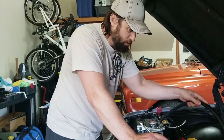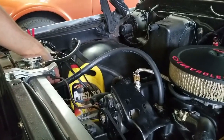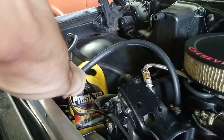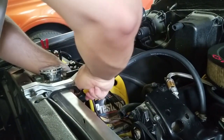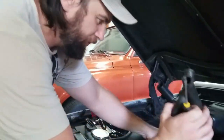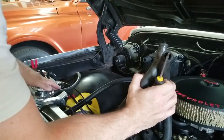So I'm going to take these off and we'll see if this hose will go from here to here. So I just replaced the hose — nothing too crazy. I did spill some coolant, so be prepared for that. I'm going to tighten this back down with a flat head and then we'll top it off. This hose that was on here was definitely not rated for heat. This is what we pulled off — it doesn't have any of the white lining in the middle that gives it strength. It's just a piece of hose, going in the trash. It was just a two-foot section. Eventually down the road we're going to replace this with one that works, and figure out what that blue wire is going to. So with that I'm going to top this off.